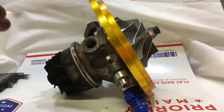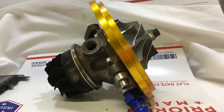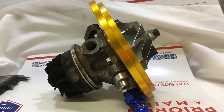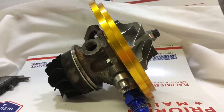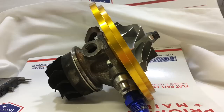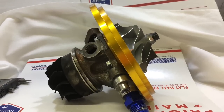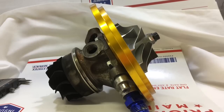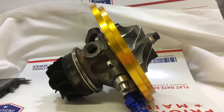On my car, the issue was the turbo was mounted too low, too close to the oil pan. If I parked it the wrong way so the oil level was towards the turbo, the oil would naturally leak out the seals. In normal driving conditions the oil sump suction prevents this, but with the car parked on a hill it would have an issue with oil leaking out the seals.